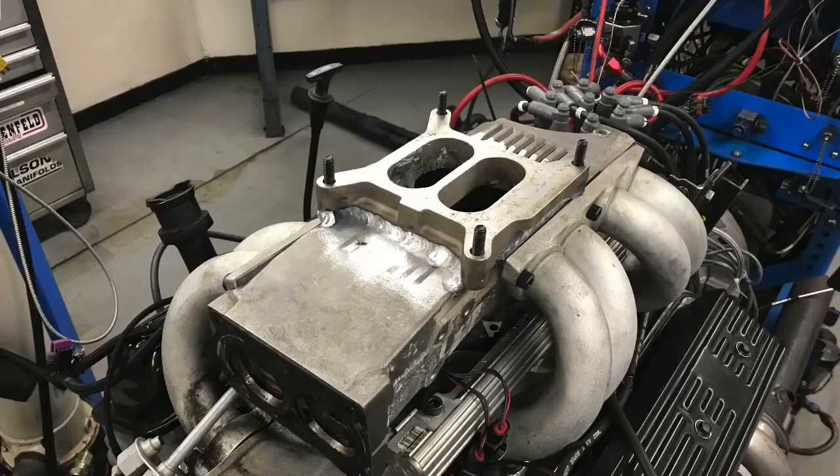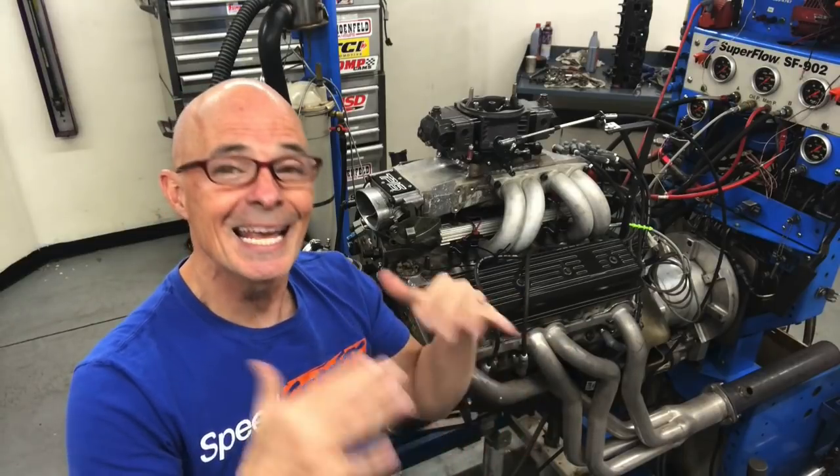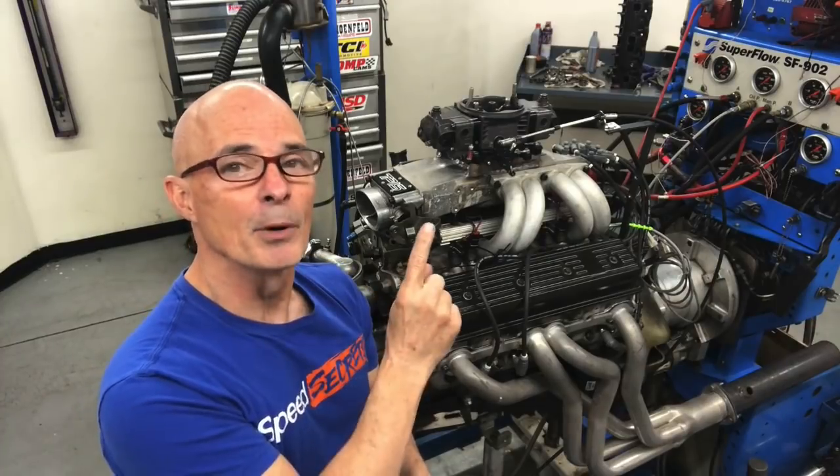What did we learn from this experiment of putting a carburetor on top of our tune port L98 manifold? Was it awesome? Did it make more power? Not so much. As it turns out, GM designed the tune port manifold with its long runners to promote torque production, and it does that very well — but it was also designed to flow air, not fuel with a carburetor on top. Does it mean that fuel injection doesn't work? Does it mean carburetors don't work? Does it mean we won't try something silly like this again? That is a big no to all three. Just wait and see what I have coming up. I'm Richard Elder — make sure to like, share, subscribe, ring the bell. Give me more ideas for this kind of silliness. See you next time.